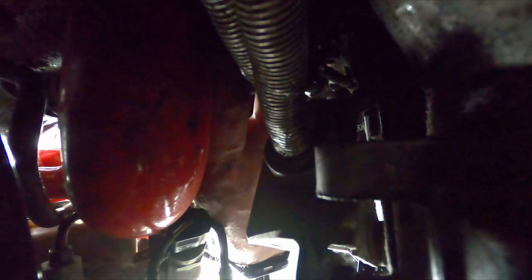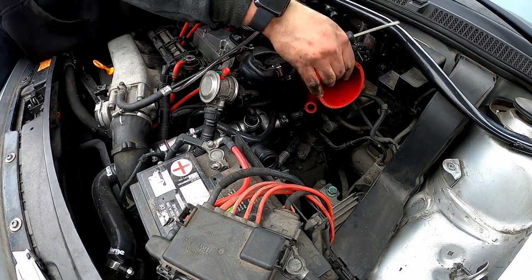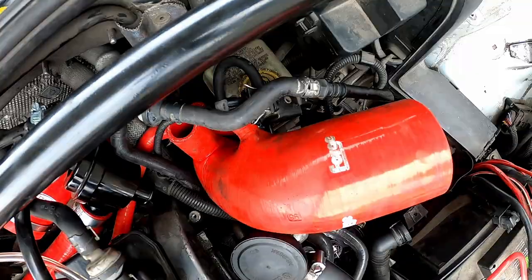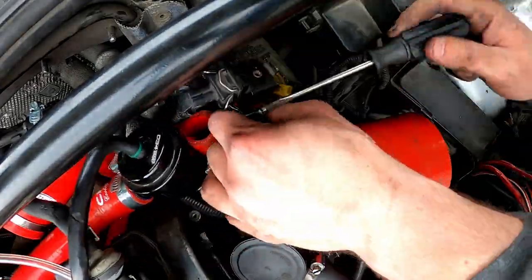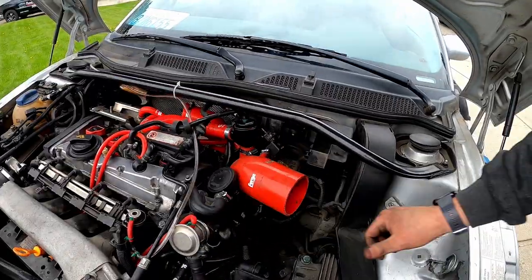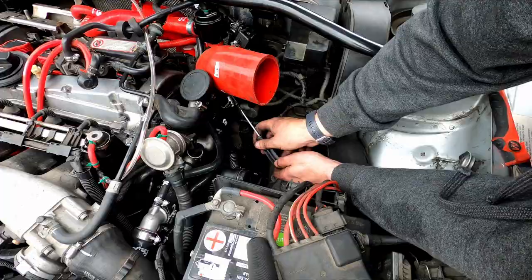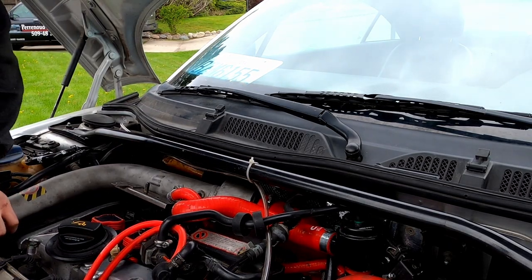This is as close to a view of the bottom of the turbo inlet pipe as I could get. The lighting down here was god-awful, and if I stuck the camera any further you couldn't actually see anything. Right where my fingertip ends is where the actual turbo inlet pipe hose clamp is. Some of my European viewers might wonder why I didn't go with an oversized turbo inlet, and it's really a pretty simple answer — there's a really good chance this pipe is going to not work when I upgrade the turbo. I got the Forge piece for a steal and it's still a fantastic upgrade over OEM. Oversized turbo inlet pipes are nice, but if it's just going to be obsolete when I upgrade the turbo, I would rather wait. I also couldn't really find an oversized turbo inlet pipe that would ship to the states, and paying all the import and shipping fees for one that's oversized would be a little bit overkill if I'm just going to replace it with the turbo. I went through and reconnected all the hoses to the turbo inlet pipe, double-checking all the hose clamps to make sure that none of them had vacuum leaks. After this I went ahead and reinstalled the charge pipe and the different pipes connected to it.